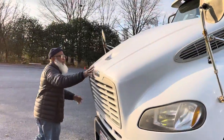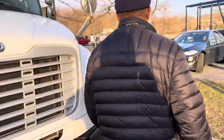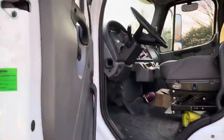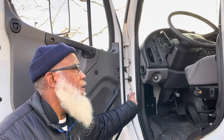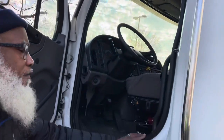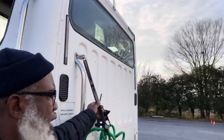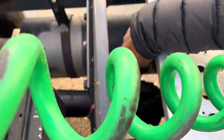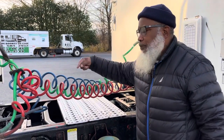Now I'll close up my hood — come to the passenger side, strap it down, then go to the driver's side and strap it down. My door on my truck and on my trailer opens and closes properly. The door hinges are not cracked, not broken, and secure — no illegal welds, no loose or missing parts. The rubber seal around the door is not dry, rotted, or frayed — not cracked, not broken, and secure. My handrails, my cable connector holder, my dummy coupling, and my drive shaft are not cracked, not broken, and secure — no illegal welds, no loose or missing parts, and no debris wrapped around my drive shaft.